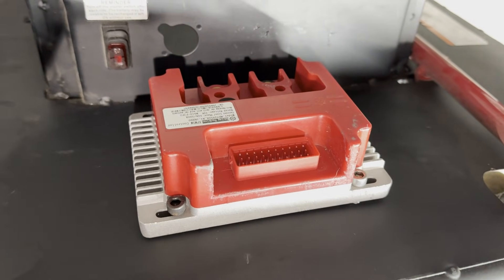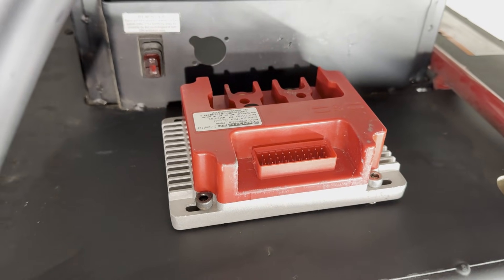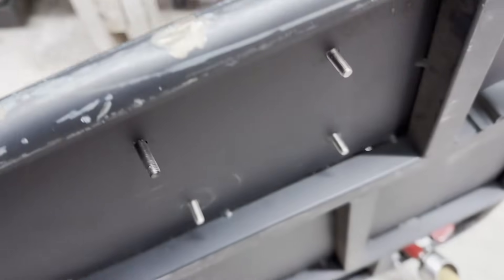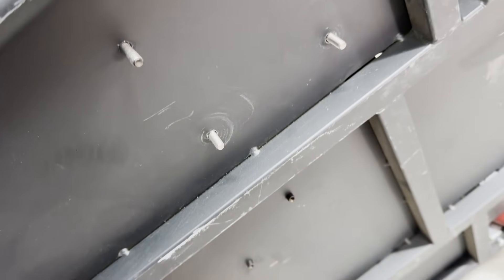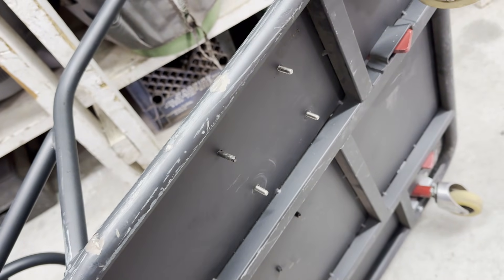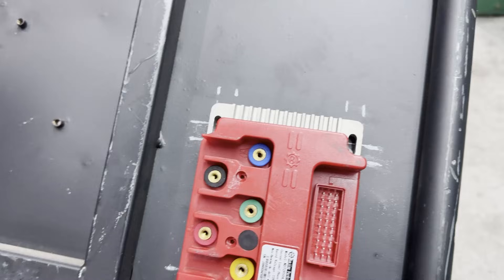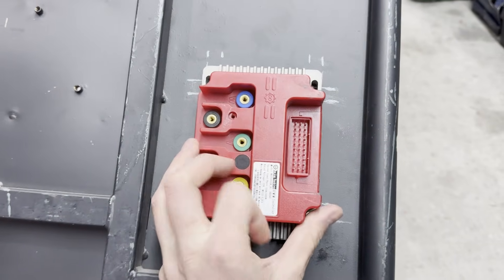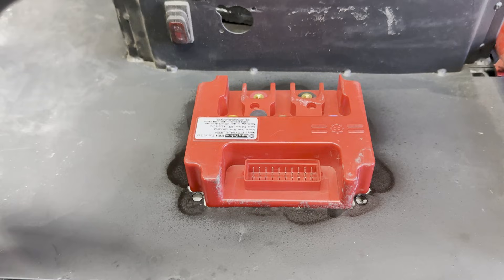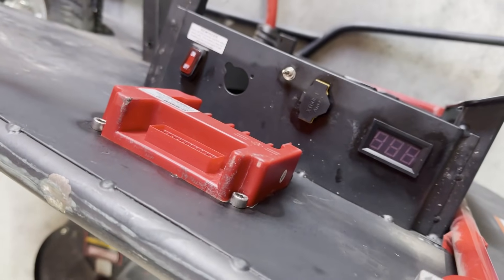The first thing I want to do is mount up the controller. I'm going to be using this 50-amp Far Driver controller. I decided to just bolt it on here since there's no way I can fit it in the battery compartment. However, if I just bolt it on there's going to be no airflow to the heatsink and it might overheat. So instead, I'm going to flip the Crazy Cart over and use some chalk to make an outline of the controller so I can cut a perfect hole to match it. With the controller like that, the heatsink can get cool air from the bottom with all the connections sticking through the top.